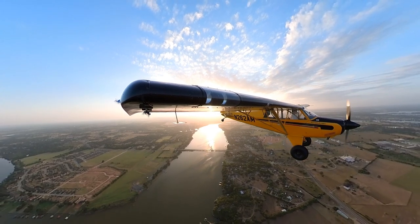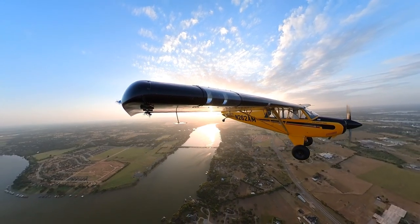For me, the weight savings and the smoothness of the prop are the big reasons I switched. I like elegant design and I did a video on that before. For both flights, the temps were about two degrees different and the density altitudes were 100 feet different — so pretty close. The winds for takeoff were pretty much exactly the same, and the winds at altitude were identical. True airspeed cockpit readings were 121 for both flights.